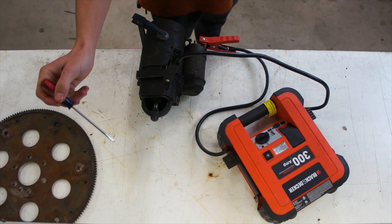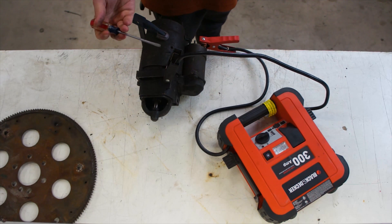There's no excessive heat, so that means we've got a good starter. If you have excessive heat, you're looking at a bad starter. If your Bendix gear isn't coming out or it isn't going back in, you also have a bad starter.